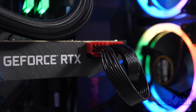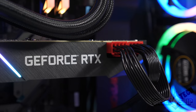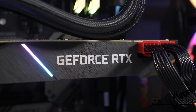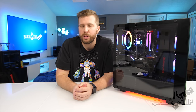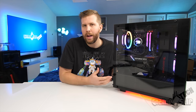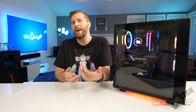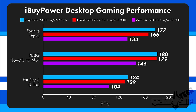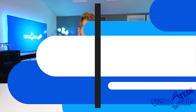This machine comes with a single-fan RTX 2080 Ti by Asus, which delivers generic-level 2080 Ti performance. The main issue is that the 2080 Ti generates a lot of heat, and with only one fan it can only disperse so much — meaning Asus has power-limit throttled this card more aggressively than you'd see on a dual or triple fan card. I still got really good overall performance, but you won't see the ultra-high boost clocks — roughly a 5–10% performance difference compared to a dual or triple fan setup.